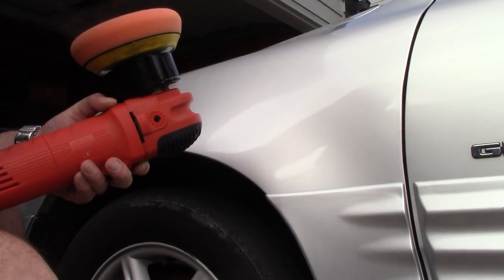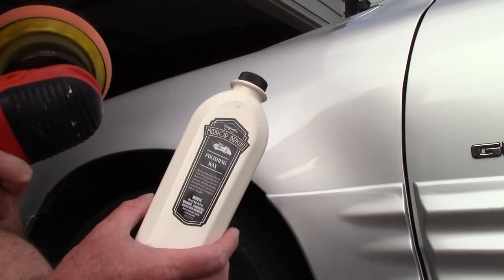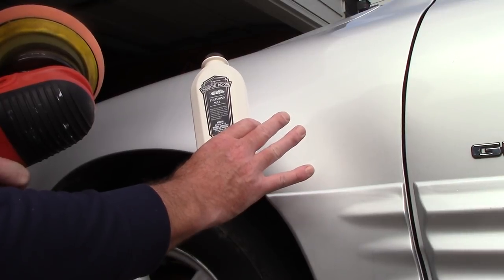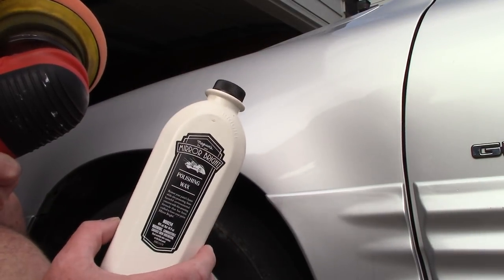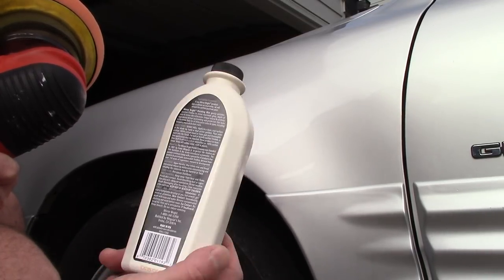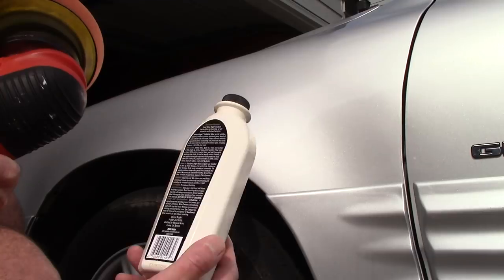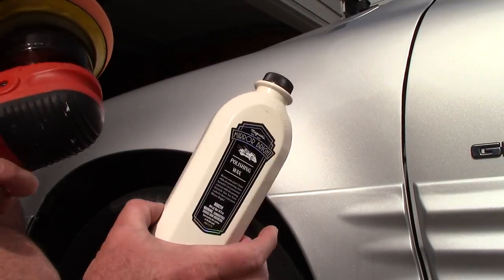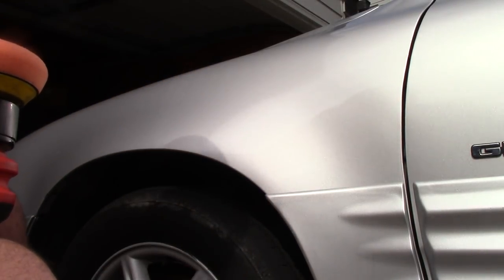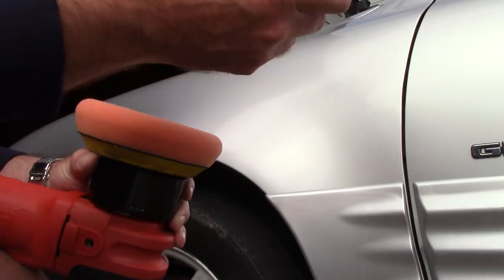What's very interesting about this stuff: when I first started playing with it, I thought I was going to be extremely disappointed. It seemed to want to flash very quickly — almost like it wanted to dry up on the panel relatively quickly. But that wasn't the case. This stuff will start to run clear as you work it over the panel with a dual-action polisher. You can use it by hand, but Meguiar's also recommends using it with a DA polisher — and you're going to get better results that way. What I love about this stuff is the working time.